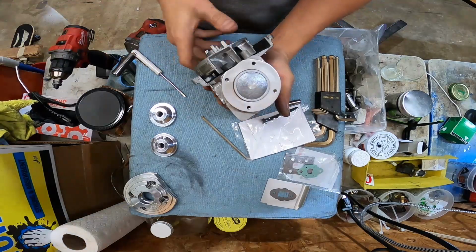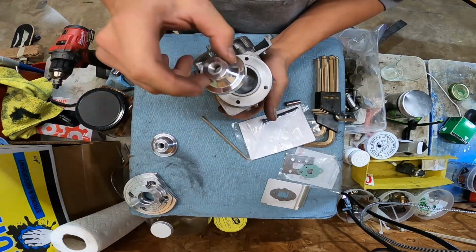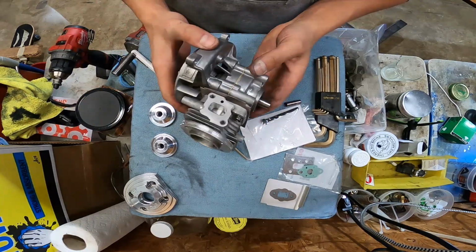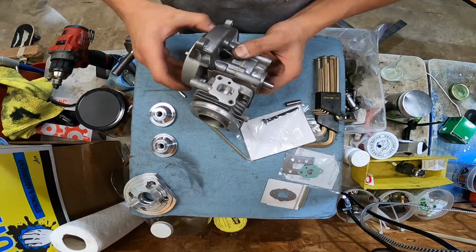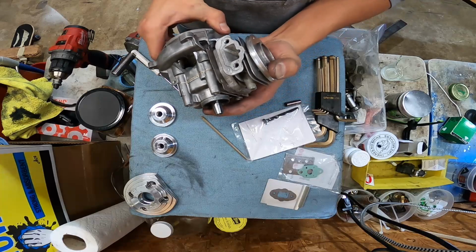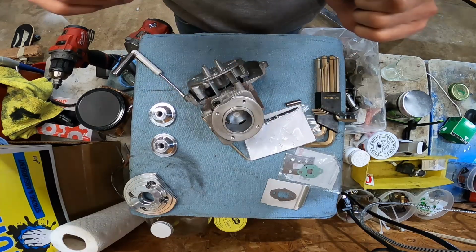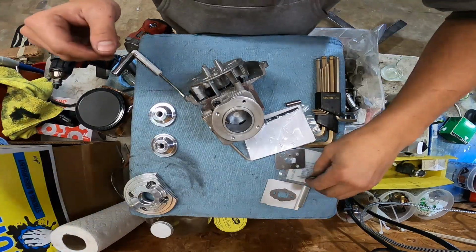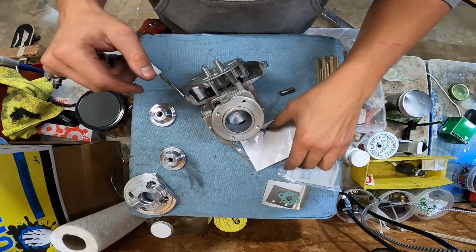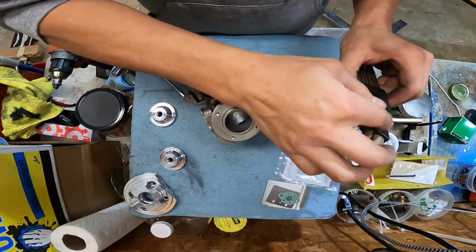Alright, so now what I need to do next is get the hardware for the head kit. I am for sure going to run a 16:1 dome on there. We're going to run VP110 with Model 800 at 32:1, 4 ounces per gallon, with the Sick Toys pipe. This thing is going to be a little ripper, guys. As soon as I get the hardware, the rest of this video will continue. And then the video for me putting this on the little mini bike will continue.